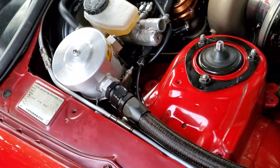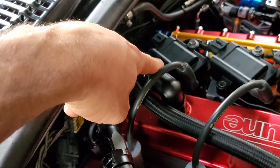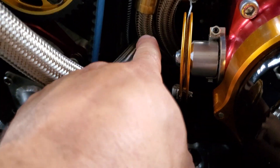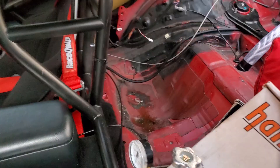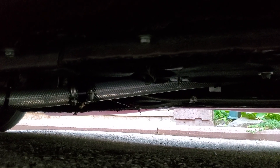For the catch can setup, there's an AN16 line that goes to the tank just to breathe. I have a whole separate system going towards the back - an AN12 here, an AN12 here, and a massive AN20 coming from the block. They all join together with big inch-and-a-half holes going towards the back, and there's a monster catch can at the back that exits there - you can see the holes. There's also a small drain so when oil builds up in the hose, you can drain it.